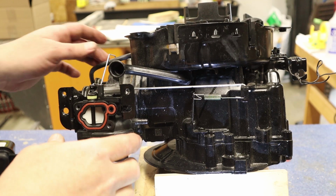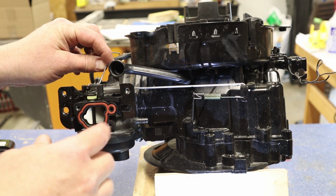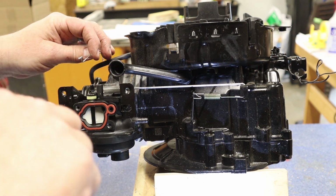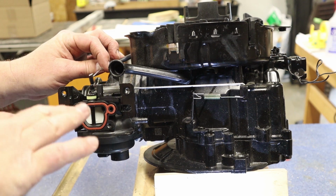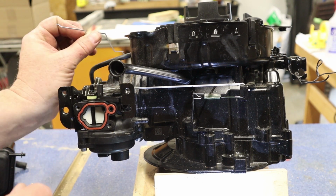So now with the carburetor, this arm is loose that went to our exhaust, that went to our choke here. So that's fine. We're going to take this out. It's also a great idea to take a picture from this direction, from this direction, from this direction, from this direction, just so when you go to put this all back, you know exactly where it goes and you don't have to worry about it because this arm is oriented a certain way. We don't want to mix this up.